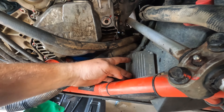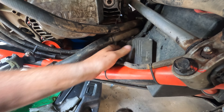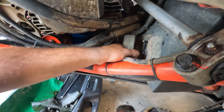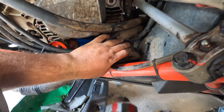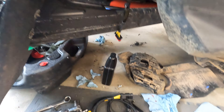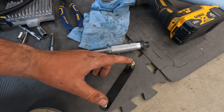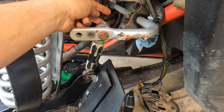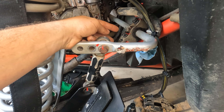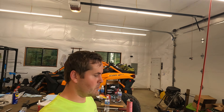The next thing is to take off the two bolts right here — I believe they were 10mm — and the stock voltage regulator should come right out. The new voltage regulator bracket has slightly wider fastener spacing, so I need to drill new holes. I'll hold it in place, mark the two hole locations with a punch, drill the two holes, then come back and get both installed.